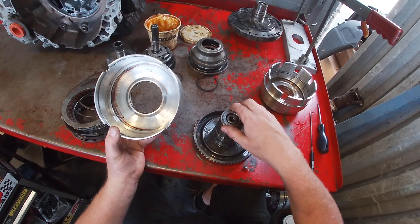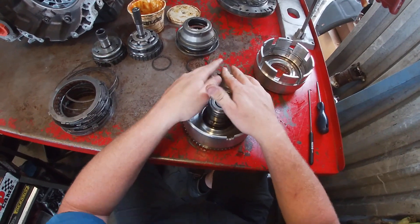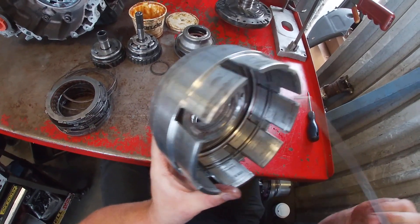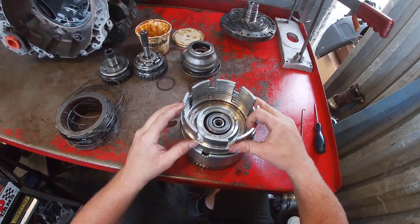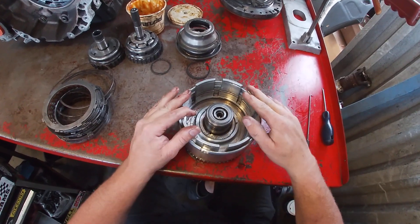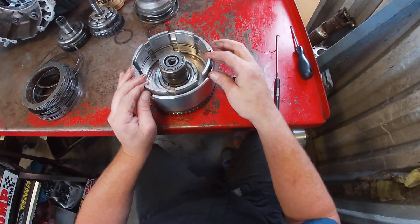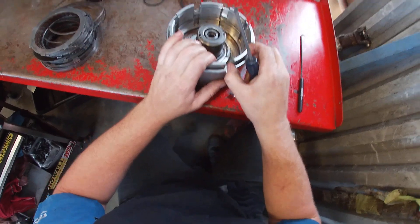We'll start with our hub assembly. We're going to put the first basket down — the orientation of this one doesn't matter as long as it is fully seated down. This other basket we do have to take into consideration: we have splines here that we're going to need to match up with splines on the input hub. We'll have to drop those down. The orientation of these cutouts will need to line up, but we can turn the outer drum accordingly. So line the splines up — a little bit of pressure helps to get it down. We can line the outside drum up, and you'll see why these two cutouts need to line up in a little bit.